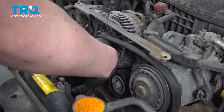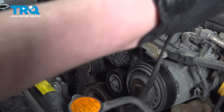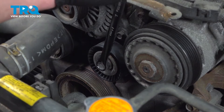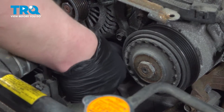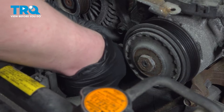I'm only going to pull the top of the belt off here. I'm going to try and leave it connected on the bottom — if it comes off, it's okay. Using a 14-millimeter wrench, break the bolt free on the idler pulley. Remove the bolt and the idler.